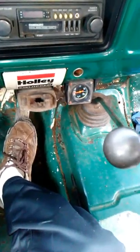I'll show you how the dump works. This is a PTO dump so it runs off the transmission — you've got to be in neutral, push the clutch in, and this is your PTO lever, so you yank it back. That connects the pump to the transmission. Then you pull this lever back to raise the dump and give it some RPMs, then let out the clutch. Afterwards you push the PTO back out since you don't need it running. The driveshaft to my PTO is a little off — the hanger bearing in the center is completely worn out so the shaft flops around.